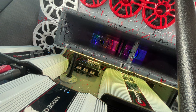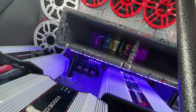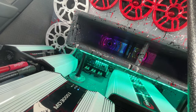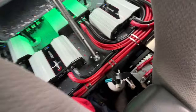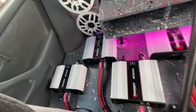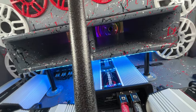I couldn't make the box big enough. Do you know the tuning on it — fourth order? 27 and 37 — it peaks at 33 and plays all the way down to 21. Do you know the cubic space on it? No. It's all right. It looks good though. You got a clean install too. Yes, that's definitely my goal — the whole inside of that area is painted, all the wires are nice and tight. Because I knew you like to stick your hand in ports, I said, I got something for Jacob.